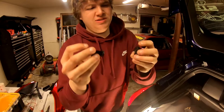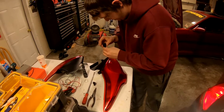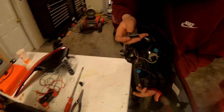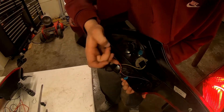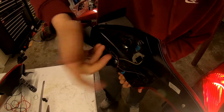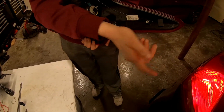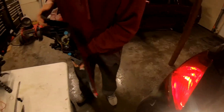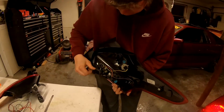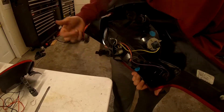This is what those little plastic clips — screws, whatever you want to call them — look like. This one goes on the top, just like this, and it holds your tail light to your car. Tighten it up, done deal. You also have this clip when you're pulling out the OEM light — make sure you remember this clip, you don't want to break anything. And don't forget to plug in your OEM wiring harness before putting it back on the car.